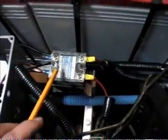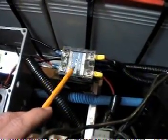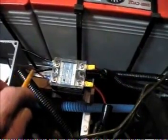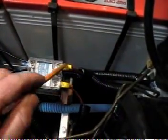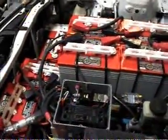This is my heater relay. I have my ceramic heater in the car hooked to a toggle switch in the dash, which can only be turned on if the fan is on. So there's no way the heater can sit there burning its way through the dash because the fan is not blowing air through it. This here is the 12-volt power that comes from the heater switch and this is the ground for that. When the heater switch is turned on, it allows this relay to pass the current through. This is the 120-volt current from the battery pack. One wire goes back into the heater relay, the other comes over and is attached with a high-amp fuse to the main battery terminal. The negative from the heater pack connects to the most negative point on the battery pack.